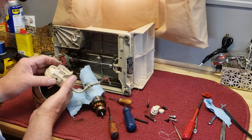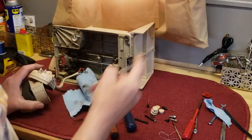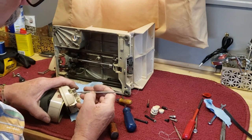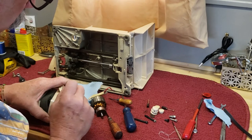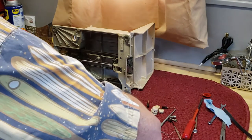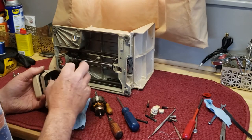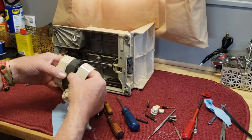There's one of the grease holes there and there's the other grease hole here. Take that dirt off so it doesn't get pushed in, and then put the grease in. You can use Singer motor lubricant, or the old Singer manuals tell you that you can also use Vaseline. Now put the winding back in place — it has a little lip that sets into the end of the housing.